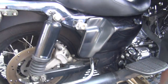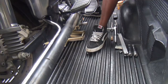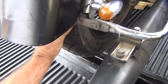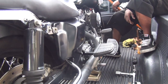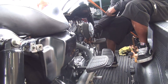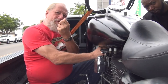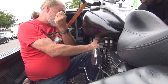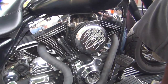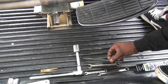Still got the screwdriver in there? Turn it over — yeah, with the back wheel. Is it all the way up or what? Yeah. No, it ain't all the way up. Where's it at? Going down. This one's going down. Put your two fingers in the hole there. They're even right now — are they moving? Coming up. Are they pushing your fingers? The lifters aren't moving? Okay, we're going up on the other part. What part are we up on? All the way up — that's it? That's it. They're not moving over here. That means you're on compression stroke — firing order. Okay, now you can put these pushrods in.